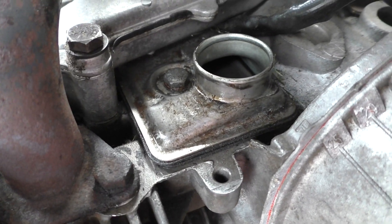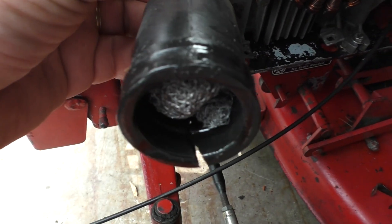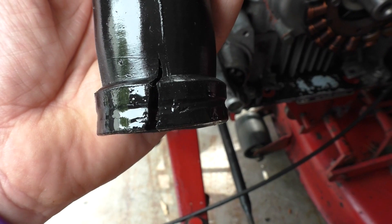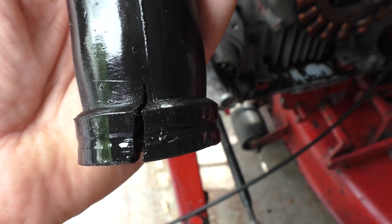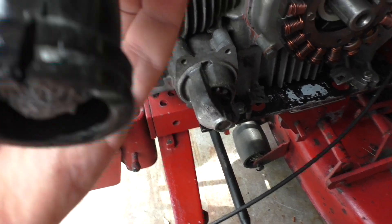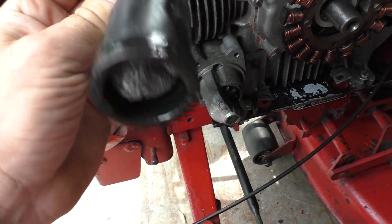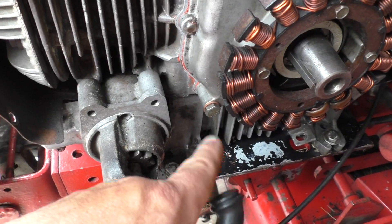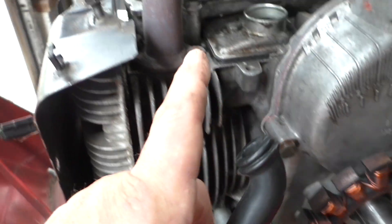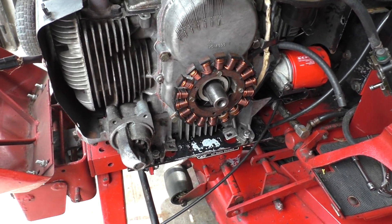I noticed a little bit of oil and I had tightened that breather, but look what I found — a nice big tear. That's a big tear. It was hidden — most of it was hidden by the clamp and I couldn't see it. I just saw what I thought was a little tiny piece of rubber, then I put my finger on it and noticed the big crack. So I ordered a new breather. That's the reason this was all covered in oil, though I did have an oil leak down here too — that's now fixed with new gasket and silicone. But this was just blowing oil all over.